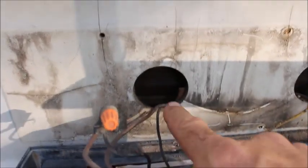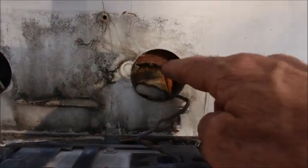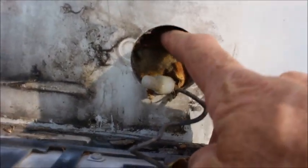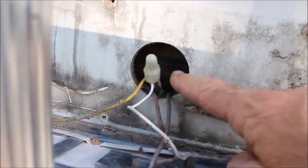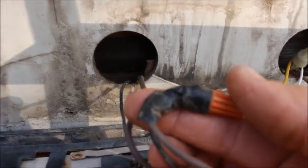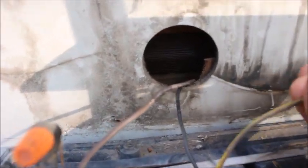We have it loose now. You can see here where the water damage is coming in - these holes in here. As the water hit the back of this it just ran in, went down through the hole and went right inside the RV. On the inside you can see a piece of old plywood still in there. We went to tear it all out - there was old insulation, the rats had eaten all the insulation out. I can tell someone's already been in here because these are just plain old wire nuts, taped on. I also see the ground strap has come loose from the part in there.